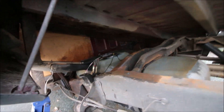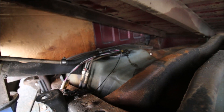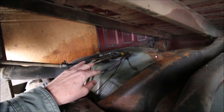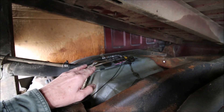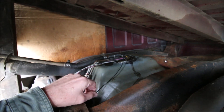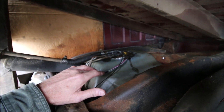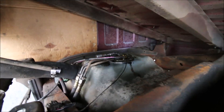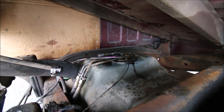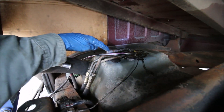With the bed up and out of the way, I went ahead and took a wire brush and worked around the ring for the fuel pump, sprayed some soapy water on it, worked it in really well, hosed it off, and blew it out with the compressor. I did the soapy water, brush, hose, and blowing routine about three times because I really want this clean before removing the ring. This truck is 30 years old running the original fuel pump, so I knew things were not going to go smoothly. I had to cut the rubber hose that goes between here and here.